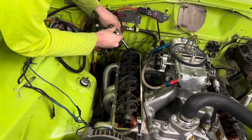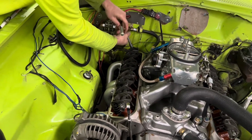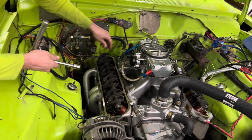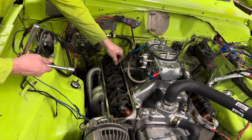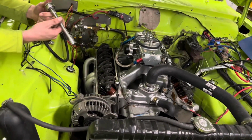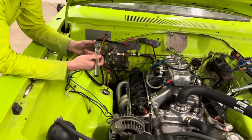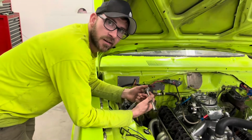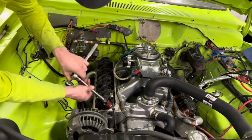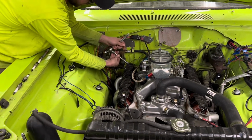Yep. And then we'll put the valve covers back on, put the plugs back in it, and the cylinders will be sealed until we're ready to work on it. Because for us living up north, this thing could be down for 6 months before we run it again. It'll be April. That's not 6 months. End of April, beginning of May. Yeah. The last 2 years, May 1st or something has been our start day. So yeah, might as well ease the pressure on the springs. Yeah, it's all pretty loose now.